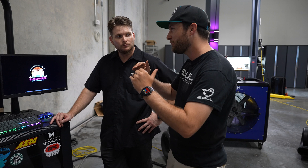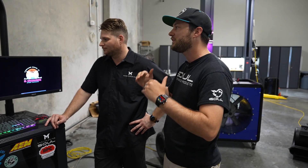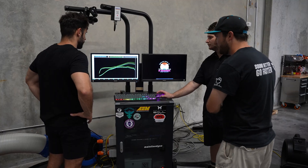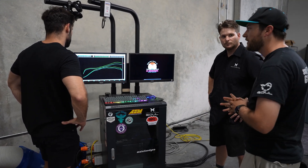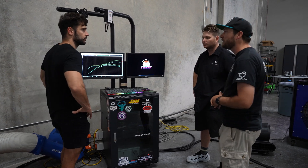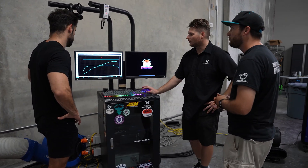With some tuning and correct fueling targets, that can get smoothed out — see how much flatter the torque curve is. As you make more and more power, the emissions-driven software limitations become more amplified from just the exhaust changes. The car just wants to make more power, and the stock software keeps beating it back down. As soon as the tune gets involved, it smooths everything out. For track-oriented competition guys, adding competition headers on top of over axle pipes is your best return on investment for power. Now, with most of the exhaust return on investment addressed, let's bring software into the equation on a full race exhaust package — OAPs, headers, and muffler deleted for weight.